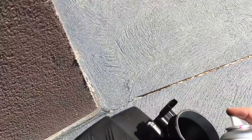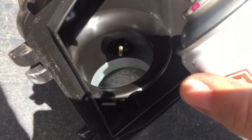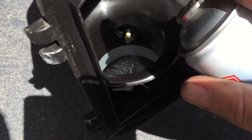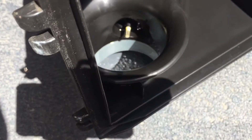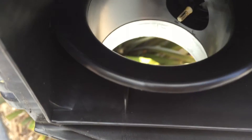Time to clean the mass airflow sensor. That's in the lid of the airbox — that little pin right there is what all this expensive spray is all about. That's the one we believe has been playing up. Give it adequate spray to clean it from both directions. Very important: do not brush it or rub it with a rag — just hit it with the spray.